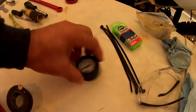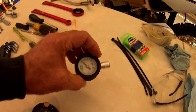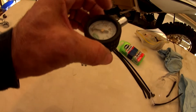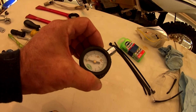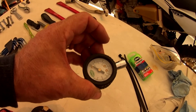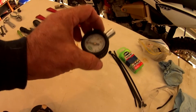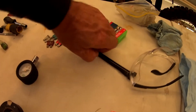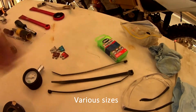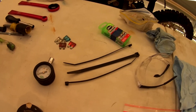I carry a little tyre gauge — a cheap one from a service station. It's not super accurate, but I worked out where the markings were inaccurate against my good gauge at home. I know that when this gauge reads 10, there's actually 12 PSI in the tyre. That gets me out of trouble on the trails. Zip ties — can never have too many. I've seen guys ride home with tyres held onto the rim with zip ties wrapped around, and it works a treat.